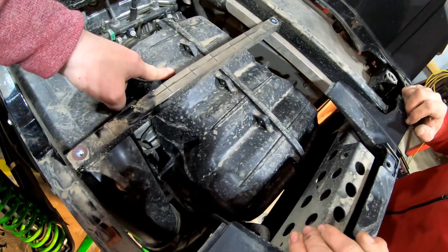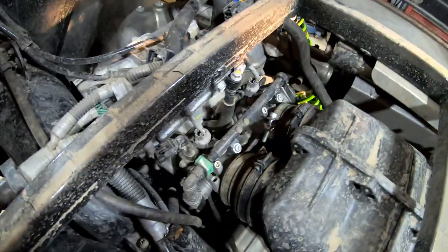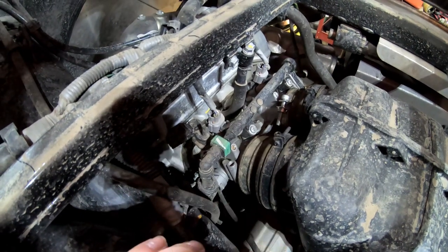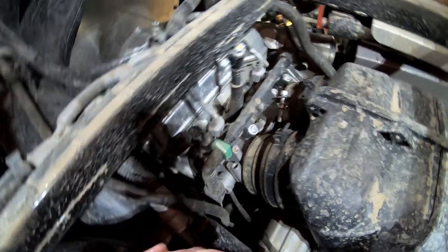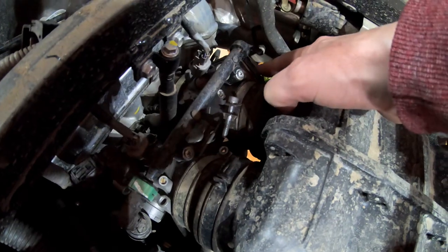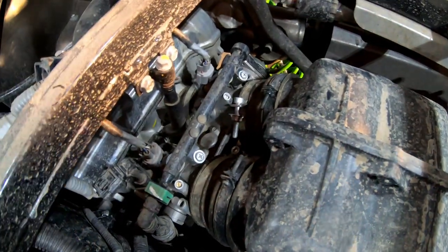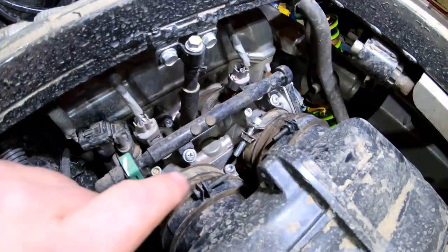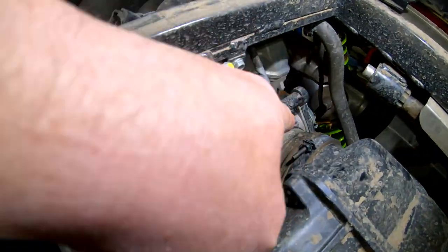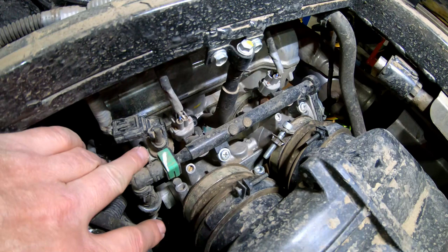This giant airbox will be a problem for turbo unless these guys have a solution to bring it up to pressure. One thing that's interesting about the Kawasaki is the dual throttle bodies. I'm not really sure why they did that, but they are electronic and linked as one. You can see the actuators over here, and the butterfly linkage comes all the way through to the other one. Looks like a common fuel rail that's terminated — no return — direct injected right into the intake.